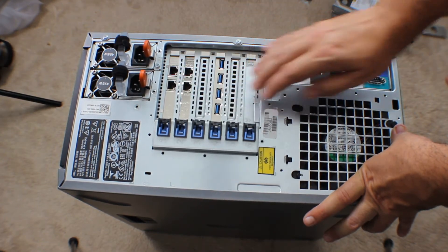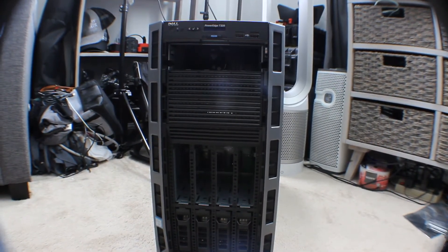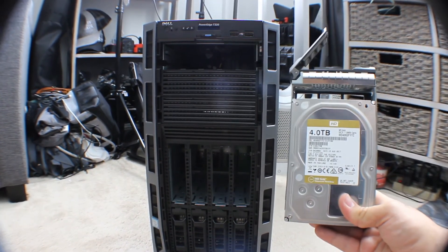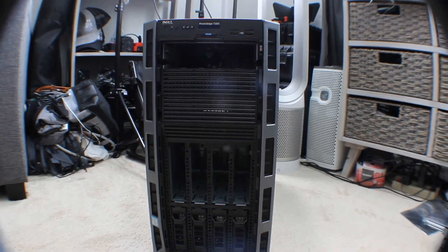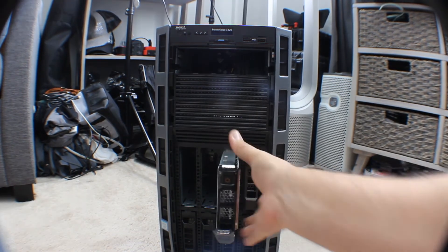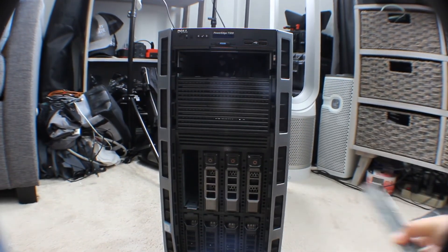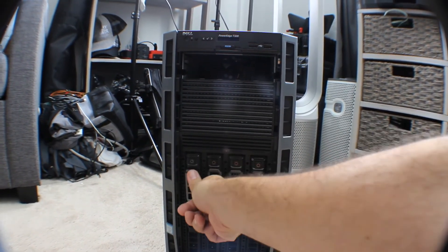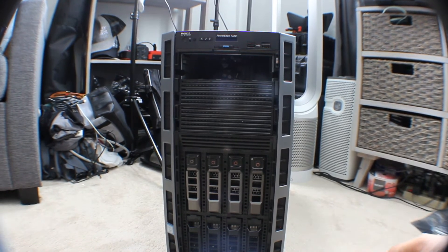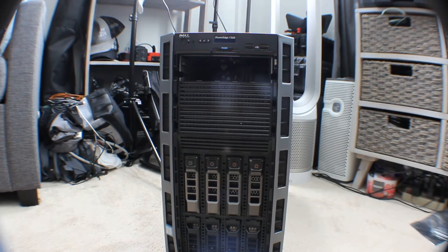Now we have redundant power supplies. We went ahead and added our NIC and USB 3.0 — this thing is ready to rock and roll. Now looking at the front of the server, we're going to put our drives in here. We're going to do 4 drives, because we have four 4-terabyte drives, which is going to be plenty of storage. Go ahead and slide all those drives in the front — push it all the way in first, then click it in. Once we get all the drives in here, we're going to go into our RAID controller card and set up RAID. With 4 drives, I like either RAID 5 if you really need all that storage, or RAID 10, which is going to be a lot better for performance. RAID 10 is going to help since they're not the fastest drives.